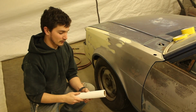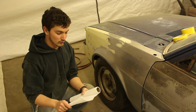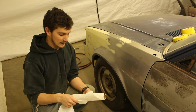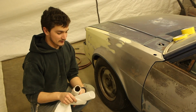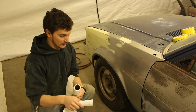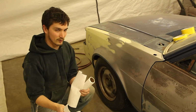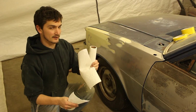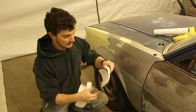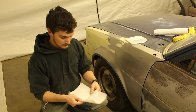So we're going to go ahead and wipe this off. I like to do two paper towels, one that has the solvent on it and then another one that is dry. This stuff suspends all of your greases and your oils in it. So the first one is basically going to put the chemical on, and the second one is going to take what is lifted off of it. I take just a sheet and fold it in half, and that's normally efficient. So we're gonna do that.